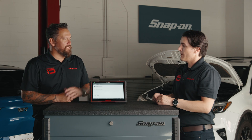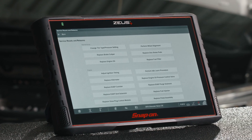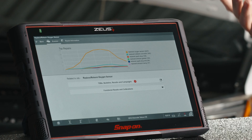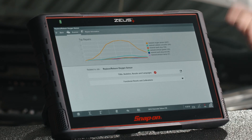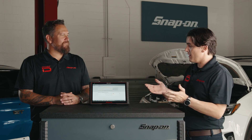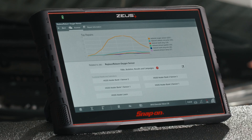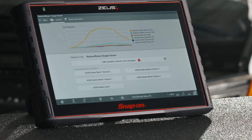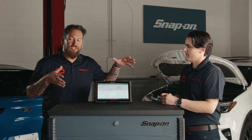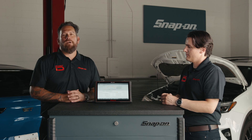I want to show you Service Resets and Relearns. What Service Resets and Relearns gives you is all the functionality you need to repair a component — either during the diagnosis or after the repair. I'll show you Replace Relearn oxygen sensor. The graph looks familiar from Intelligent Diagnostics: it gives you the top repairs related to an oxygen sensor, maybe components replaced along with it, plus TSBs and recalls. What's great is it provides the functional tests you need to do during or after repair. Here it shows the oxygen sensor Heater Learn — a technician may not know they need to perform a Heater Learn after replacing a component, and that check engine light with that code may come back. So much information and knowledge packed within here — it's all about diagnostics, process, and efficiency, engineered for the technician in the workplace. The Zeus Plus.